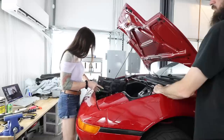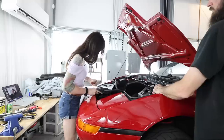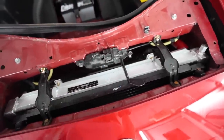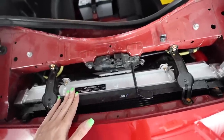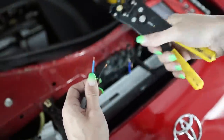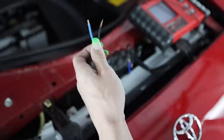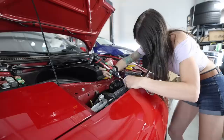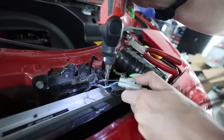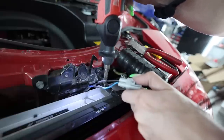This is likely because I don't have the best cooling fans. About three years ago I upgraded the cooling fans and put in a new radiator because the other radiator was dinked up. Now only one cooling fan is working — the condenser fan isn't. I had this radiator apart a couple times when I was getting the AC working because the condenser lines were leaking and stuff got tugged on. Let's not focus on why the fan wasn't working, let's just focus on the fans now going to be working. Soldered. This is a lot quicker than getting my heat gun out to shrink these.